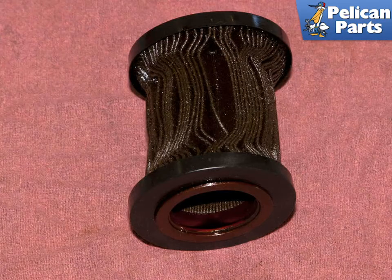This image shows what can happen when a low-quality oil filter is used. The filter can collapse and fall apart inside the oil filter housing. If your filter is bent like the one shown, inspect the filter housing and filter cover for oil filter debris. A broken piece of filter will jam and crush the new filter when you tighten the cover.